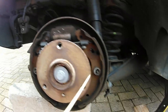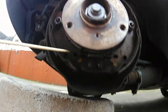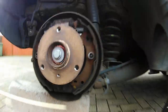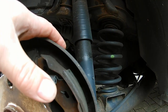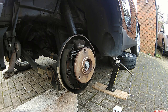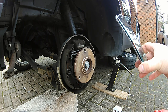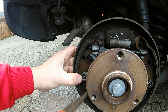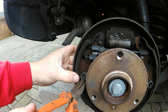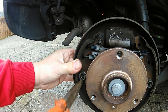Here are some locking pins with sprung retainers, and at the bottom another spring. Behind these brake shoes is the cable. These are the brake shoes — the things that rub on the inside of the drum to slow the vehicle down. There's also a handbrake cable behind the drum which we'll show you in a minute. Here you can see me just taking some photographs so that if I take it apart and forget how to reassemble it, I can always go back to them — and believe me, it's very useful.